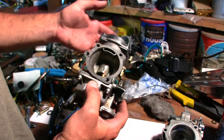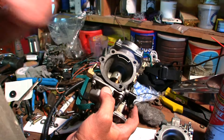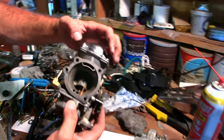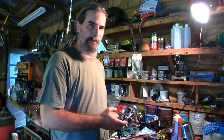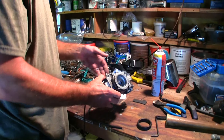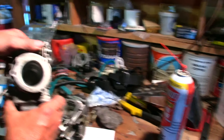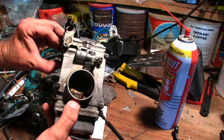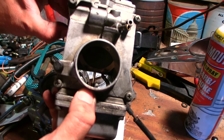The reason CV carburetors were invented was to help the rider when going into different altitudes — you wouldn't have to readjust or change jets. As the RPMs are higher on the motor, that creates a vacuum. As more air passes through, there's a diaphragm on the top side, and it opens this slide up, pulling this needle up, which is your main jet, adding more fuel. So basically when you're in the mountains and the air is thinner, this thing self-adjusts according to altitude.